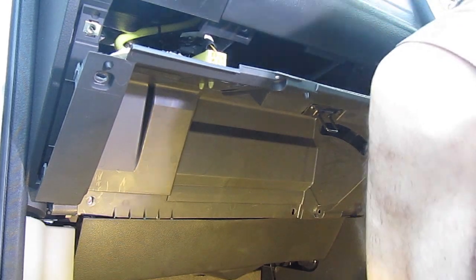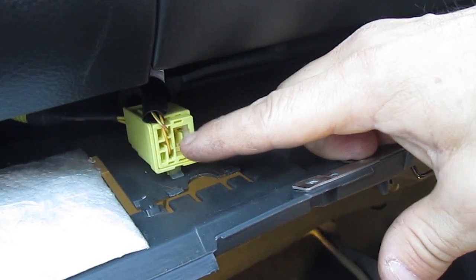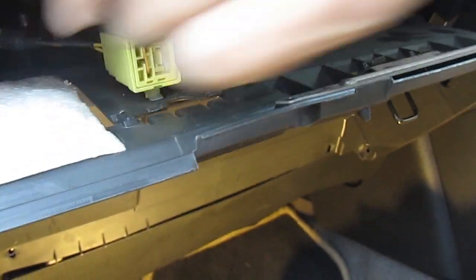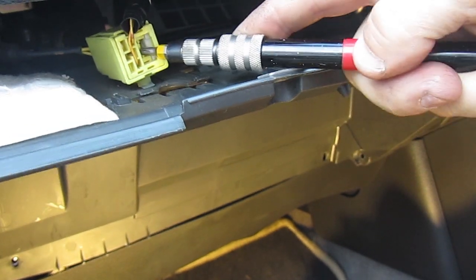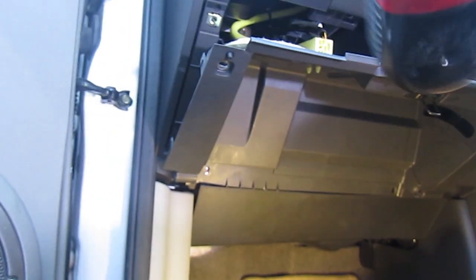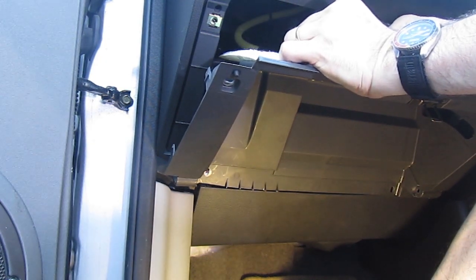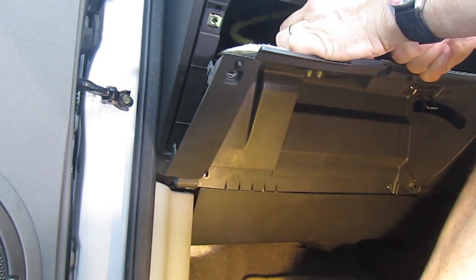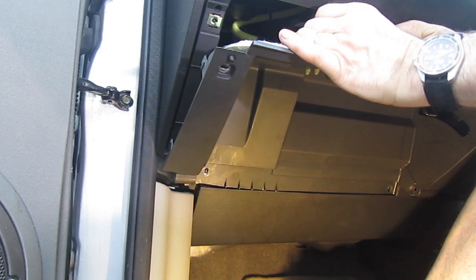The wire on this is very tight; you can't actually get it down very far until you've taken it off. What I did was disconnect the electrical clip — I removed one clip from the other. I think I put a screwdriver in the end of it and popped that electrical connection apart to remove the front end, which is fine, but the downside is that there's not much cable spare on the back end either. I should really have edited this bit out, but I'd rather show you the mistakes I've made.